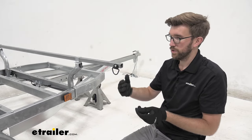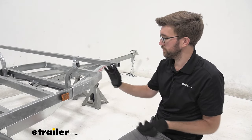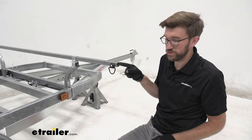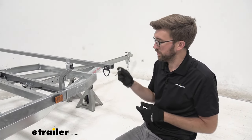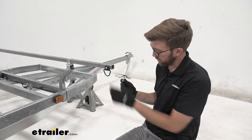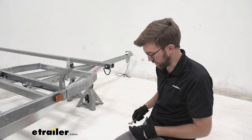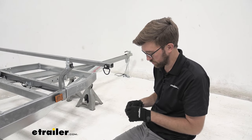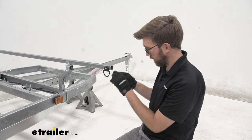There's nothing to pass through on the inside, so you have to get the nut in there without your finger reaching far enough. You can put it on a 14-millimeter wrench if possible — place it on either end of the wrench to help thread it in. It's a minor inconvenience but creates a really clean finished result once everything is secured.